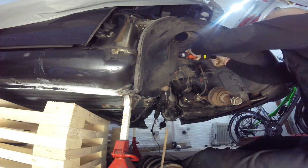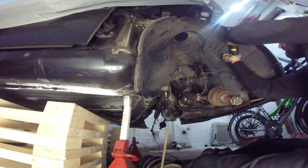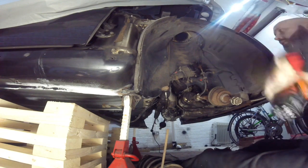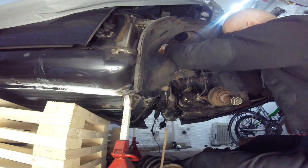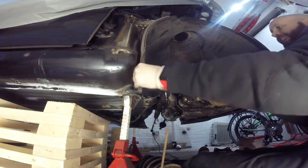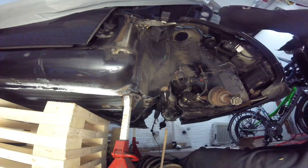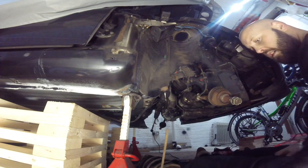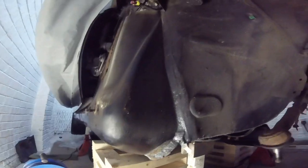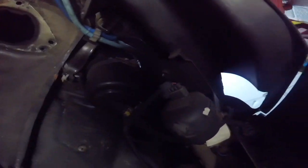There's a hint of oil - a few oil leaks under there though. It was very wet around the sump, maybe a sump gasket. I also had an oil leak coming from the rear bank rocker gasket which I did last year. It should all clean up really nice. And there's the dreaded oil cooler.